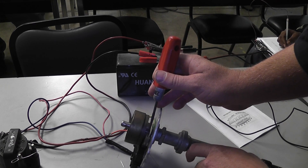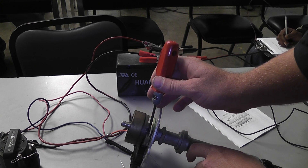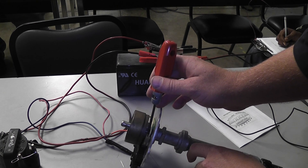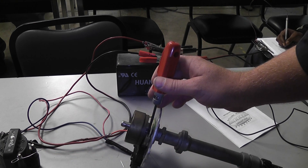What I'm going to do is touch it on and off the P pin, which is the positive pin or the sensor positive wire. I'm just touching that on and off, and as I'm touching that on and off, you can see over here that the coil is firing every time.